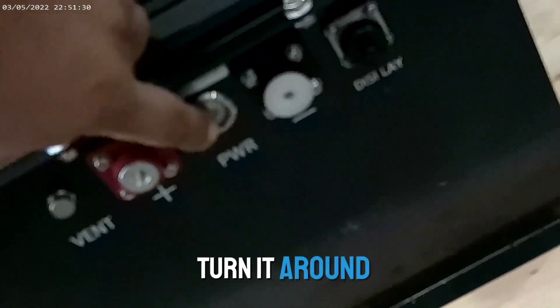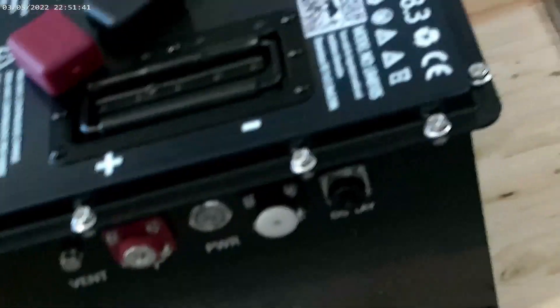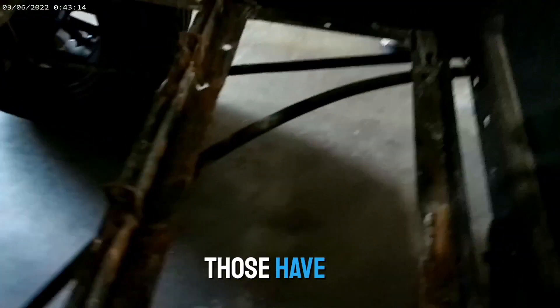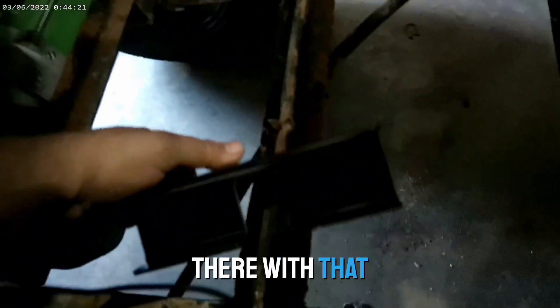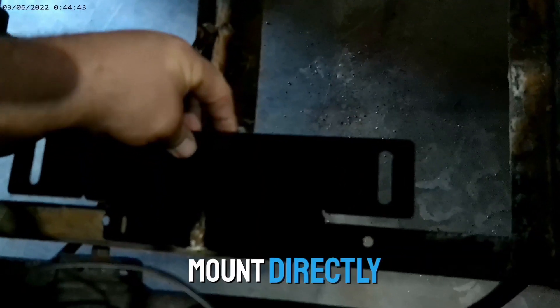Put your power button there, turn it on. And then this is just a vent, it's like the 120. On the TXT, these little brackets here for the battery hold-down are supposed to be cut off flush with the battery tray. The bracket, if you want to go the easy way, just sits over top of that rail there with that little screw. I like to try and make a little storage compartment in the front side of the tray. But the easier way would be to just drill your holes right here and mount it in, and the battery will mount directly to that.